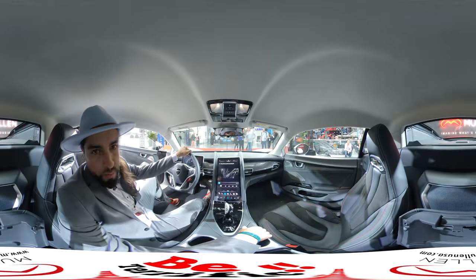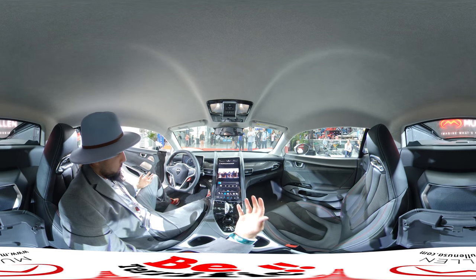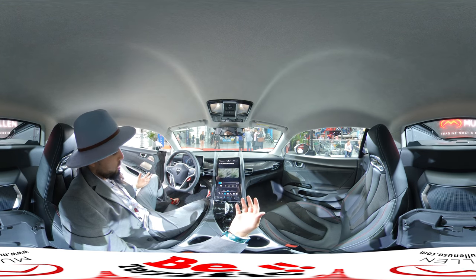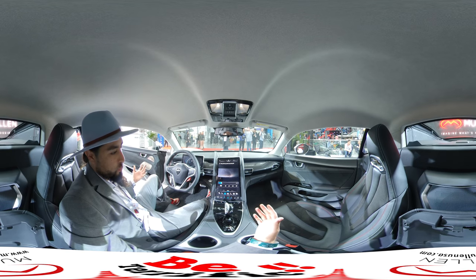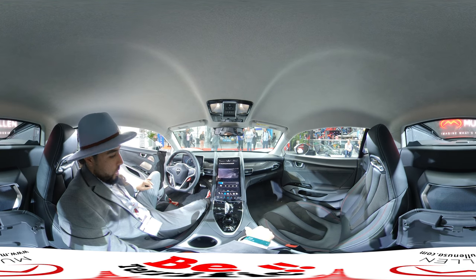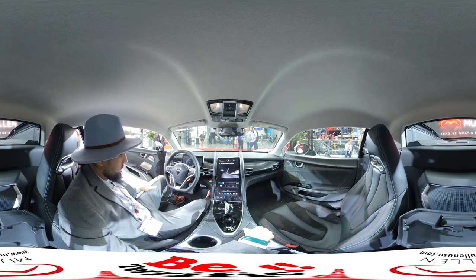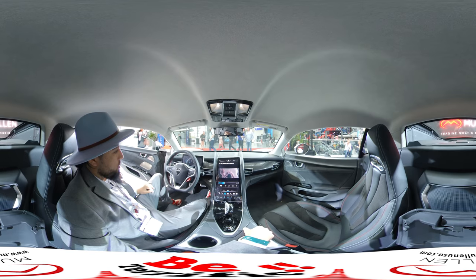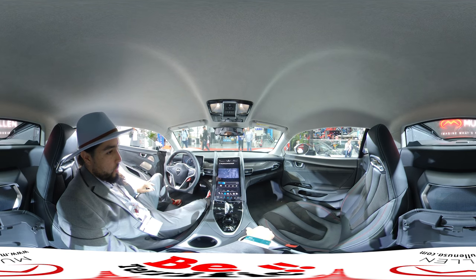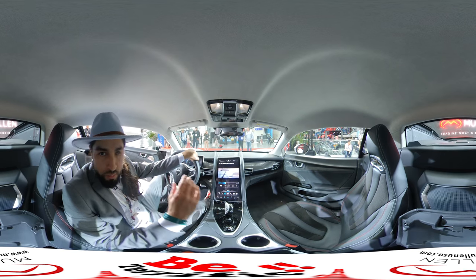The beauty of having a T-form battery pack is that it allows us to have the weight of the vehicle distributed and also a center of gravity very low, which is really necessary and important for a vehicle of this kind. That's why it allows us to have a lower sitting position, to have the balance of the vehicle and the maneuvering capabilities. It also allows us to have ideal weight distribution.